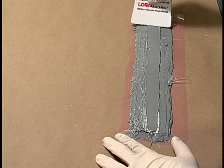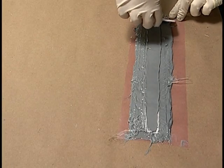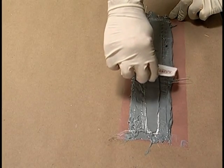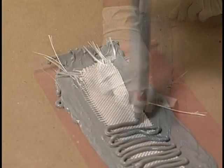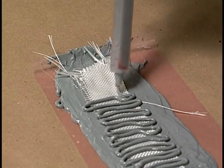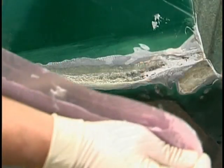It's important to work as much fiberglass cloth into the repair as possible. This controls expansion and contraction in hot and cold temperatures, eliminating read-through or bullseyes. Build 2 to 3 layers, followed by a top coat of adhesive. This patch should now form a pyramid shape.